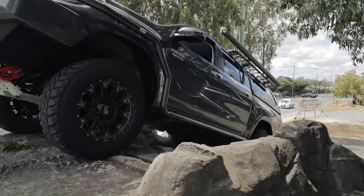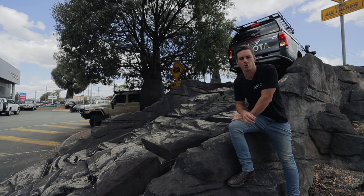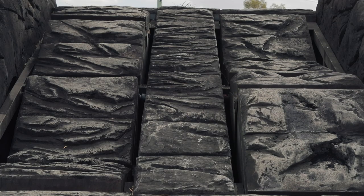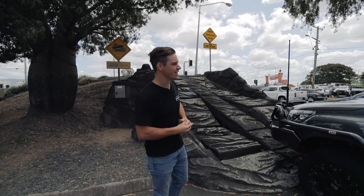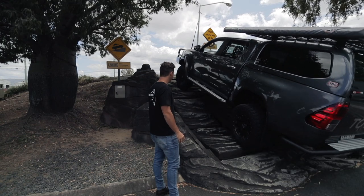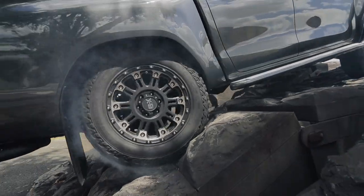What we're going to do now is adjust this ever so slightly to show you a real-world scenario where the hill might be a little bit more difficult, or you've got big wombat holes, and let's see how far a rear locker will get you. I've adjusted the truck slightly so he's going to run out of articulation — rear locker's on, let's see how he goes. As you can see, rear locker's on, traction to both wheels, but he just doesn't quite have enough to get up the hill.